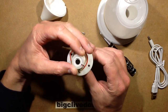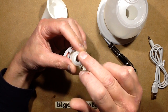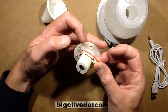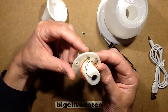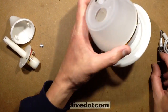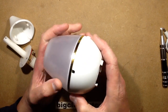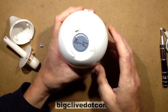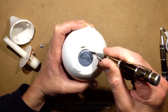Here's the ultrasonic atomizer. It's the usual piezoelectric arrangement — it's got the perforated metal disc with the piezoelectric layer of crystal around the outside that makes that disc flex and vibrate at ultrasonic frequencies. It's got a little connector and what look like just two screws with flat heads, and two nuts on them, one locking against the other with the wires. Very simple. The unit has a base plate that comes off, and there's a sticky label on the bottom.